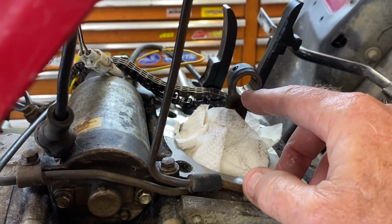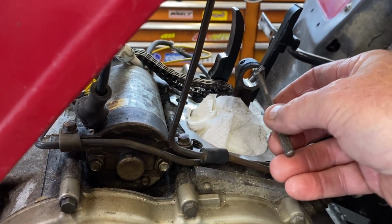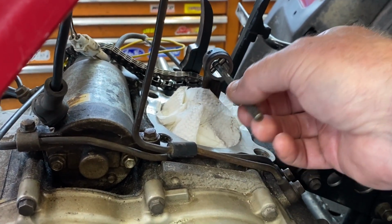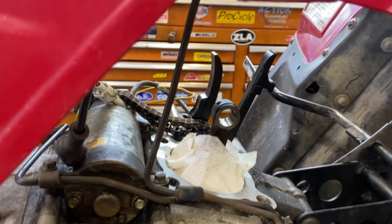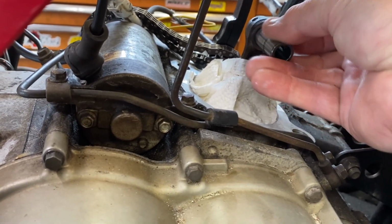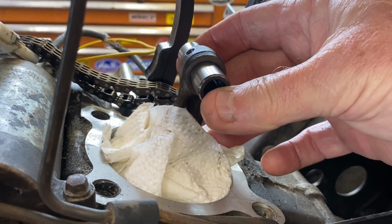Now if you go look at the connecting rod, the small end, well, that's not great either. It's round. I measured with a spring gauge, a spring internal gauge. It's round. It's pretty even around all aspects of the 360-degree range, but it's a little bit big too. Now, he said there was a knock to this engine. Top end knock, bottom end, I don't know. I can tell you right now that this clearance, when you put it in and it's centered where it normally lives, is pretty substantial as far as how much you can move it, see?